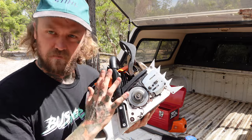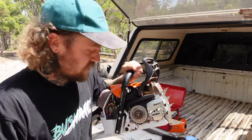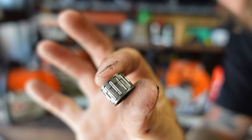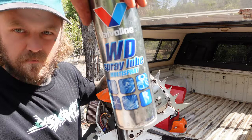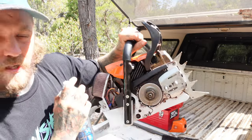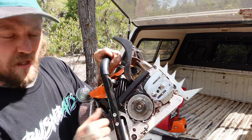Parts for these are quite expensive - not just the 500, but most of your chainsaws. Husky too I'd assume. Next thing in here you have a bearing that sits under your sprocket - which you want to keep lubed up. You don't need to do this too often, but because it's been sitting for quite some time I'm going to spray it with a bit of WD-40 - just in there. Not trying to drown it, and that will be plenty.